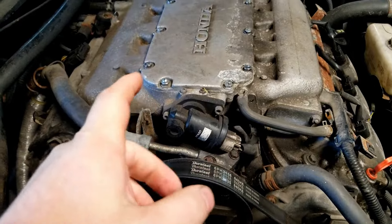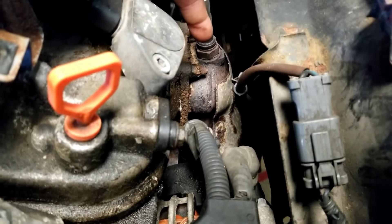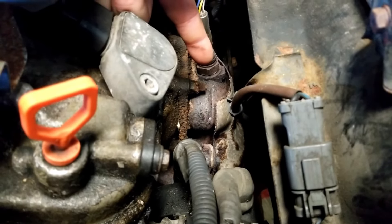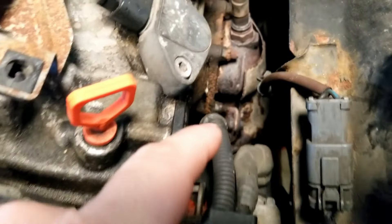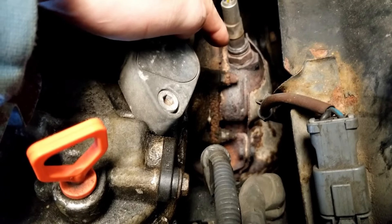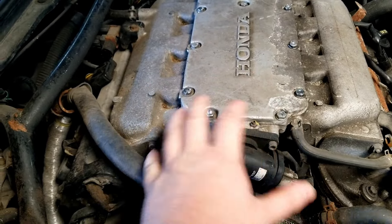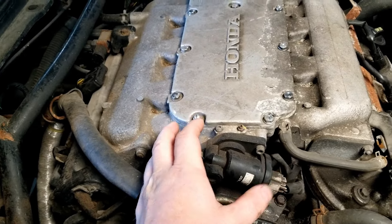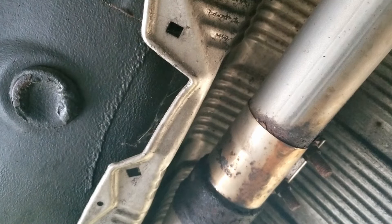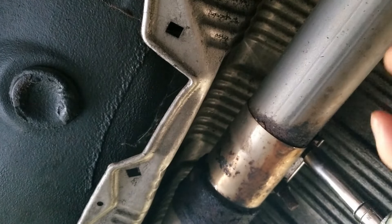Here's the little secret: you don't need cats for an engine to run. They burn off the extra fuel from the combustion chamber that didn't get burned, and they burn hot enough to help get rid of some of the other emissions that come out the tailpipe. They are not required for an engine to run. But if one of these cats is clogged, the engine runs unbalanced — that's not good. It causes all sorts of problems like misfires because the air is not flowing through the engine properly, and an engine is nothing more than an air pump.